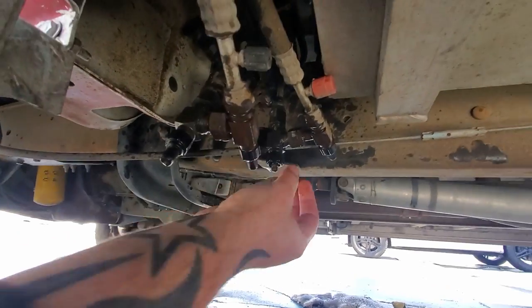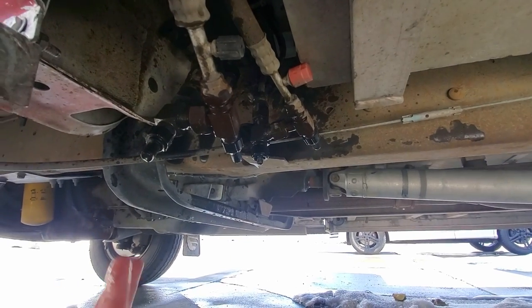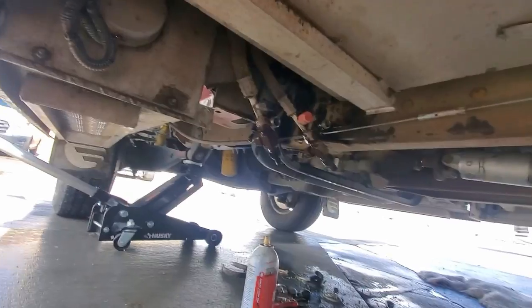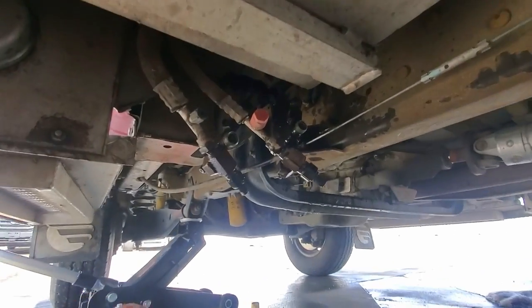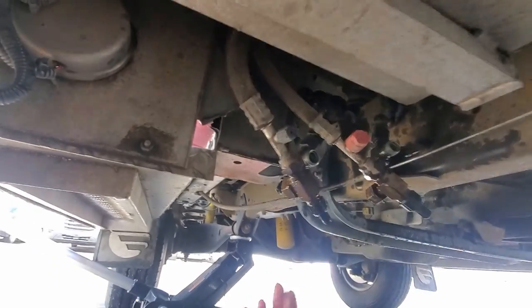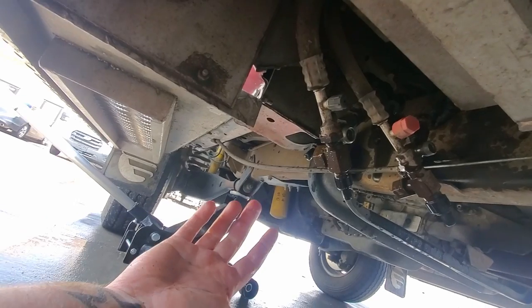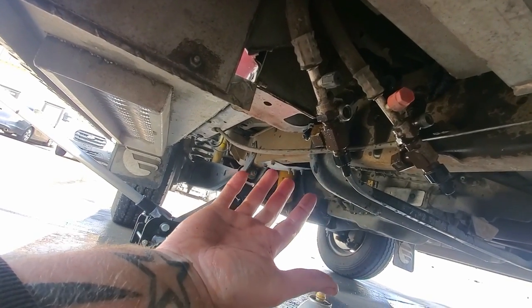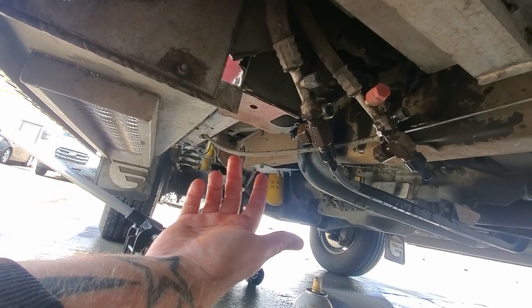Then disconnect these two big nuts, and that will disconnect the entire AC side of the rear unit, and you'll be good to go. Just wanted to do an afterthought thing. So they both disconnected. Like I said, maybe a second or two of gas came out, but it definitely shut it off. It was nowhere near the gas that's in the whole system.